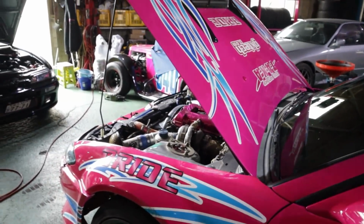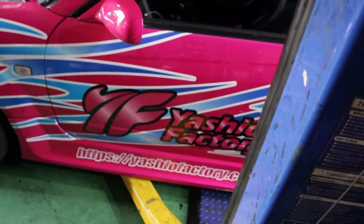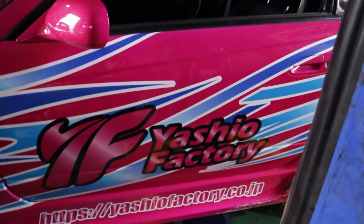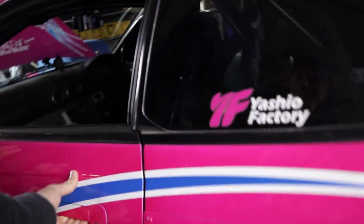We're gonna start by removing the transmission, and then we'll remove the engine and worry about all that afterwards. So let's get this thing up in the air. Bringing it back down because I made a beginner's boo-boo. We wanna remove the shifter first. So let's get in and do that. Just gonna need a screwdriver, I think, remove all this stuff, and then there's just a circlip in there and we should be able to pull that out.